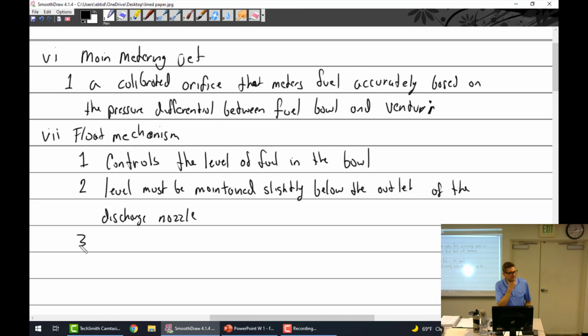Discharge nozzles and floats are notorious. That's what I was going to get. I have a collection of floats that are full of fuel. And so you have the Stromberg, and when you get into the other ones, it can be the same thing. There are these tiny little brass floats, and what happens is that solder tends to leak a little bit, and they'll get little pinholes.